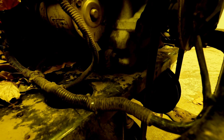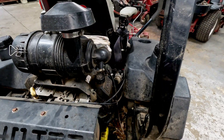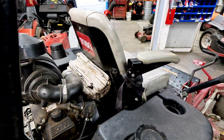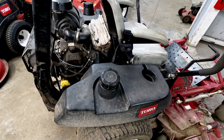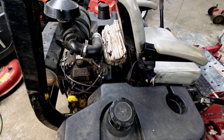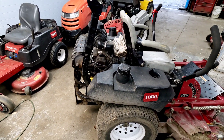The crankcase gasket — I don't see anything on this side either. I think he got pretty lucky with what was going on here, because with how much oil there was everywhere down at the bottom, I would have thought it'd be something a lot larger than just a valve cover gasket and a loose oil filter. Luckily that's all he's got at this point. The front PTO shaft is completely dry up front — the PTO shaft comes out just under this flap right down below.